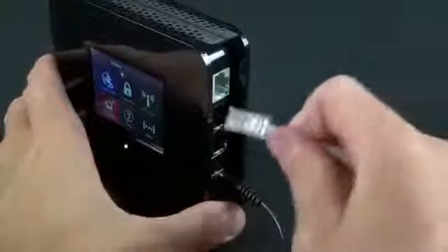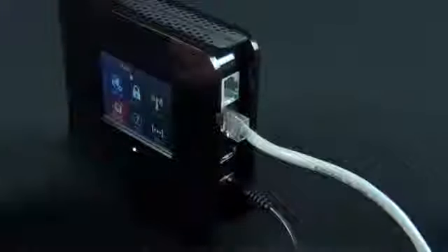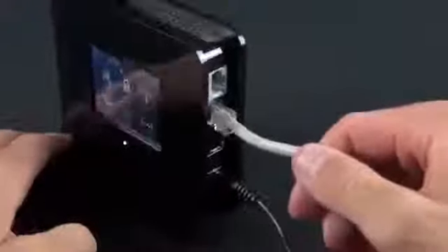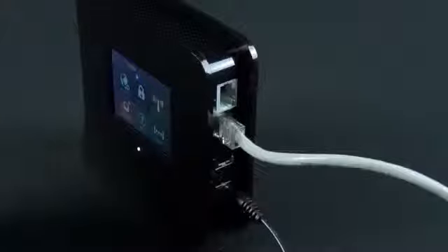In range extender mode, this device will not appear separately on your network — it just acts as a repeater for your existing wireless access point. Another benefit is that you can connect hard-line equipment directly to it, so the router becomes a wireless-to-LAN adapter. For example, if you have an AV receiver without built-in wireless but with an ethernet port, you can plug the Almond into the wall, set up range extender mode, and connect the AV receiver to it. This works a lot like Airport Express range extender mode — it both extends your wireless range and gives you the ability to hard-wire devices that lack wireless capabilities.